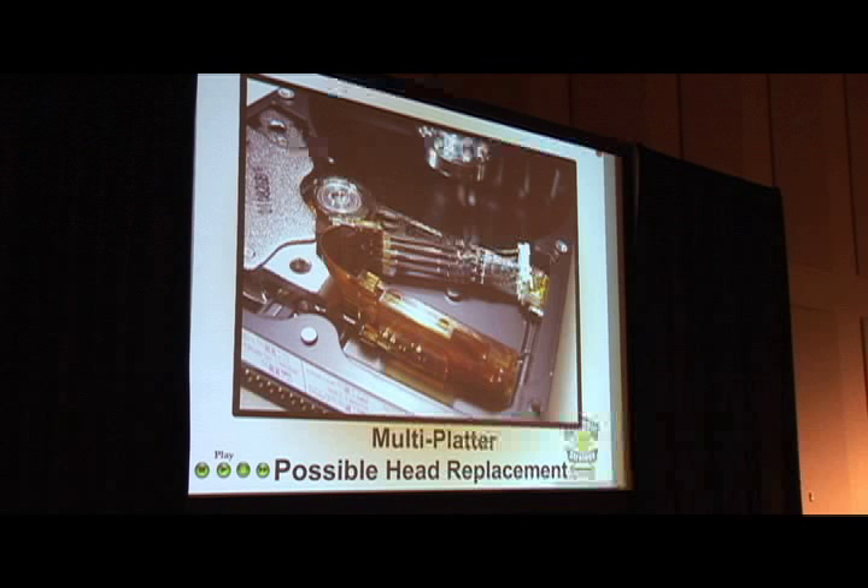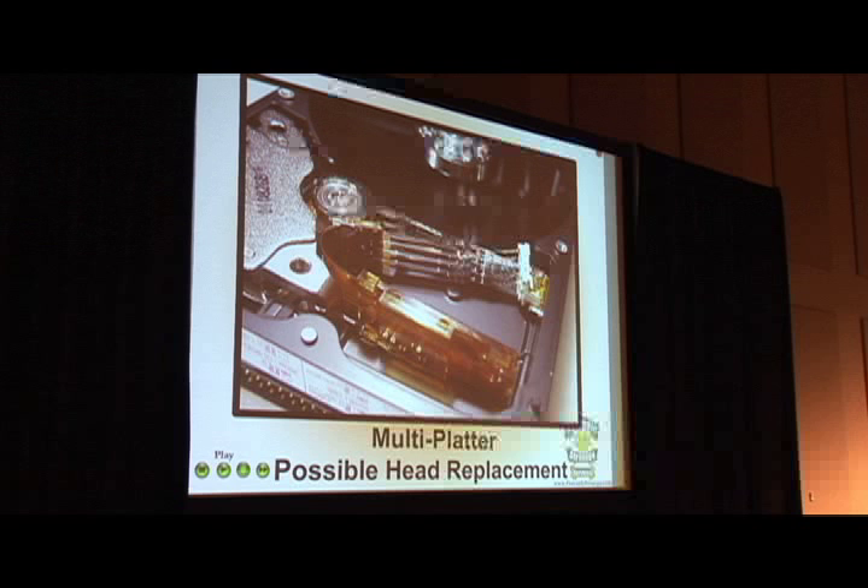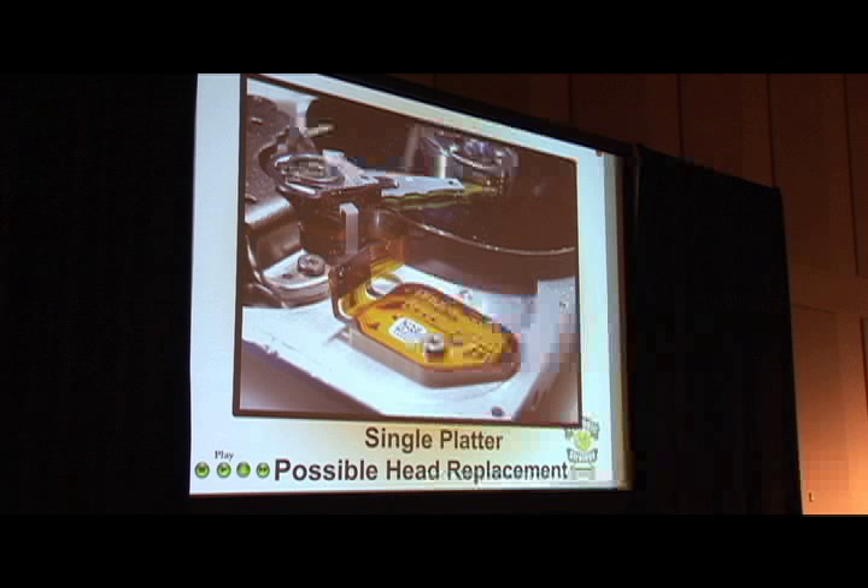If the heads slam together, they're ruined — the head itself is mounted at the end of the slider and they hit each other, so you just set it aside, buy another eBay drive, and start over. If you have a drive with a ramp, it will help you line the heads back up. Take your time and confirm they're mounted correctly, or the second you start the drive the head will hit the edge of the platter as it moves back onto the drive and you'll get metal scraping all the way across because the drive doesn't know the heads aren't aligned.